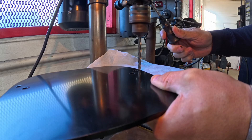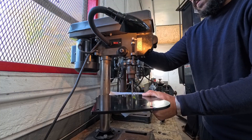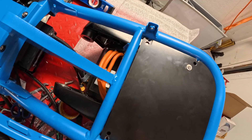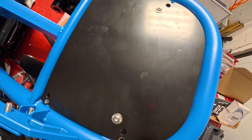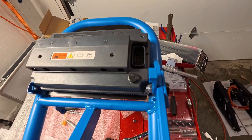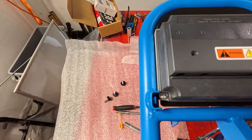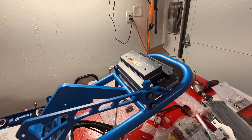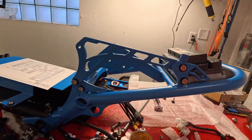This build, I went ahead and took the rear cover off of the rear frame and I'm just drill pressing a slightly bigger footprint because the controller that I got for it was not the correct footprint at all. But it's fine — we'll make it work and it'll look beautiful, it's just a matter of how you do it. You can see here where I cut the holes; they were on the edges so I didn't want to do it by hand. And you can see just how tight that is with the controller just about touching the frame — it really couldn't be any tighter. We'll see how it all fits up once I actually get the seat on, because for all I know the seat won't clear, you know, building process stuff.